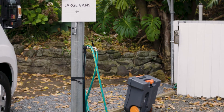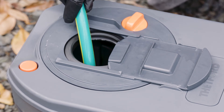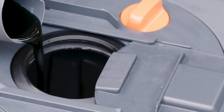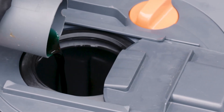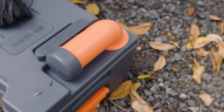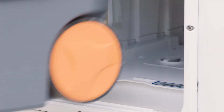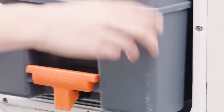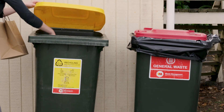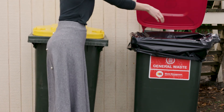Rinse and drain the cassette using the hose supplied at the dump station. Add sufficient fresh water to cover the bottom. Use the end cap to measure 50 ml of toilet chemical then pour into the cassette. Replace the end cap and swivel the spout to its original position. Then slide the lid back and turn the knob to close the flap. Gently slide the cassette into the toilet locker — don't force it. The release lever will click when the cassette is secured. Since most dump stations have a recycling station, take the opportunity to recycle while you're there.